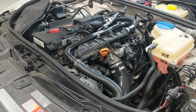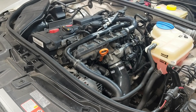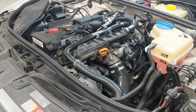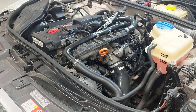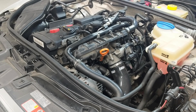So what is the PCV system and how does it work? If you don't care, feel free to scrub ahead to the next chapter and go straight to the hose install. To fully understand what role this hose plays in the overall system, let me go through the PCV circuit in some detail. PCV is an acronym for positive crankcase ventilation, and it's all about safely relieving pressure caused by cylinder blow-by in a way that's friendly-ish to the environment and theoretically safe for your car.